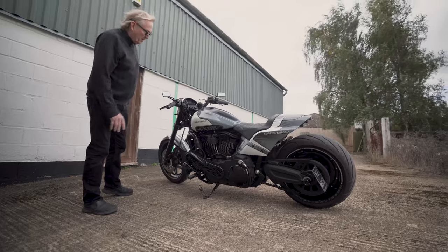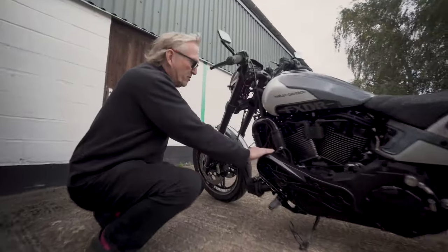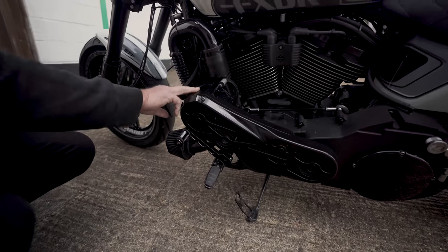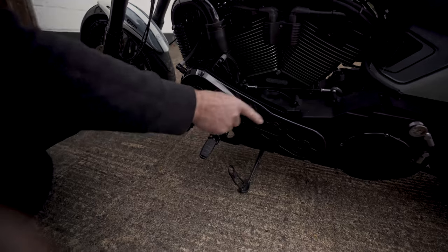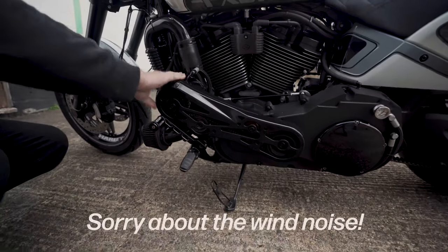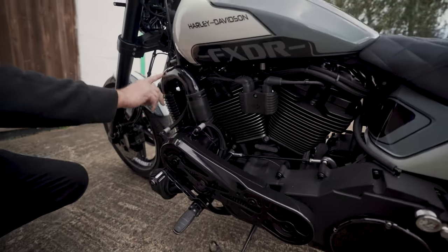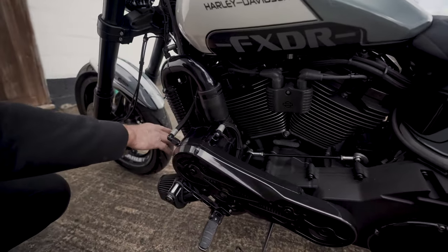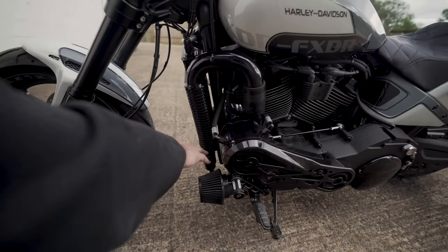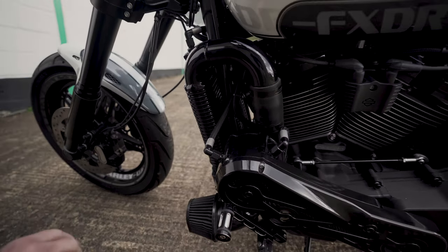As a reminder to you all about Billy's bike — we're running the Rotrex C3094 Supercharger with our Supercharger Drive tooth belt, a 30mm tooth belt. This baby on this bike is making 22 pounds of boost. Really, really efficient intercooler — we get very little pressure drop on the intercooler. And it looks pretty cool as well with the fin tanks on the sides. People don't recognize it as being an intercooler.